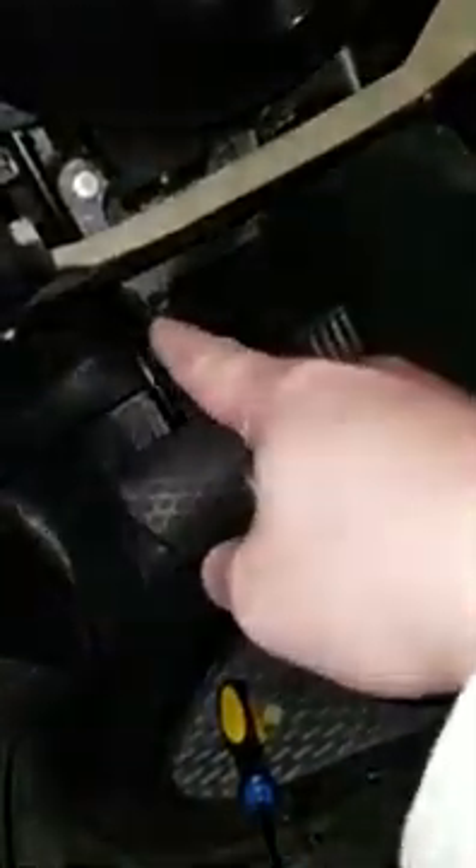It's this key right here. So basically what you're going to do is pull the computer out of the car — it's the EWS computer. You're going to unscrew this from the bottom of the driver's side. It's basically three screws across the top, a clip over here to the right, and then another clip back there behind the brake pedal.